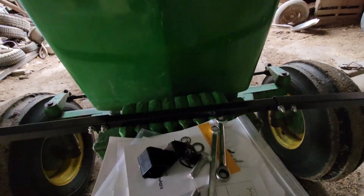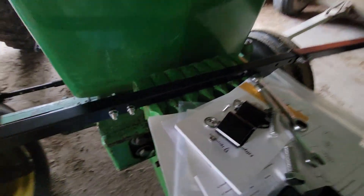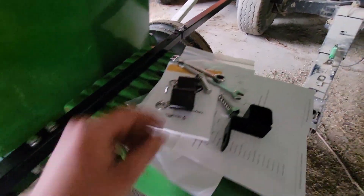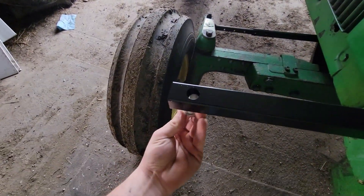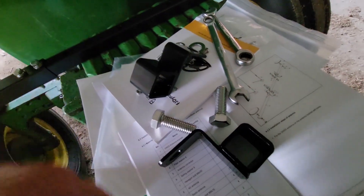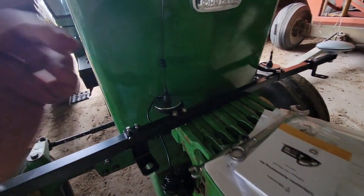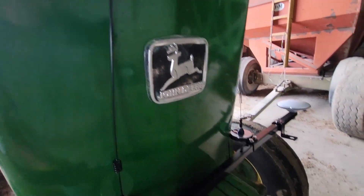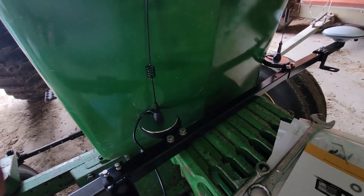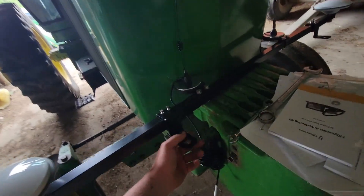Should work with the light bar bracket, but if it doesn't I'll have to make some modifications. Not many people have a light bar in their tractor. So we're going to put the GNSS antennas up through here, one on each side. And then we've got to mount the other antennas as well — which is 8 and 9, the 4G antenna and radio antenna. We've got it all set up, everything's labeled and it tells you right where to go. So far the instructions are actually pretty good.